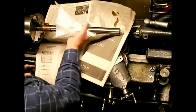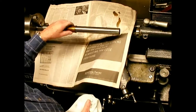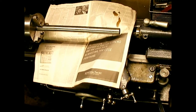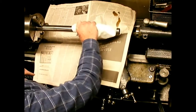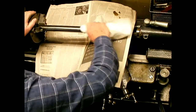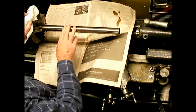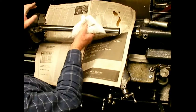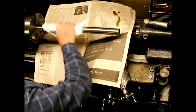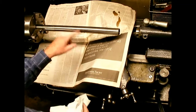It's really bad in this area — they must have bent the forks and managed to pull them back straight. I got the bushing off. I could feel a lot of divots and bends in there where it went egg-shaped — when you rub it, you can feel all kinds of ripples. This is the part that isn't good on this one. I could heat it with a torch and bend it straighter, but I think I'm going to try to find other fork tubes that are in better condition. That's how I got the bushing off there.